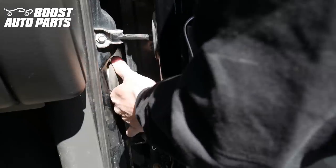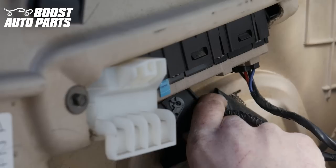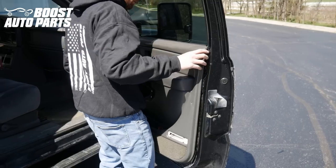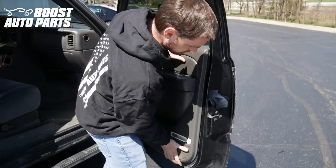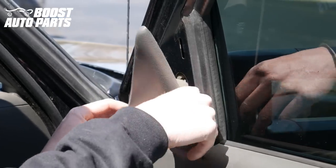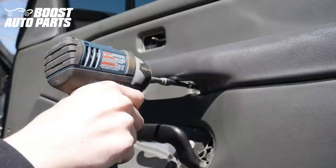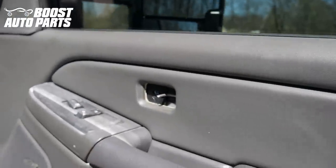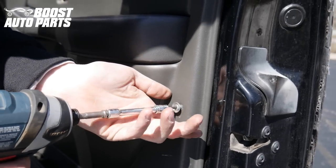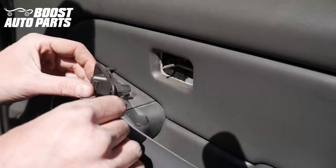We'll go ahead and snap the boot back in. Go ahead and plug the connectors back into the door panel. Now to put the door panel back on, it should just kind of latch down — you do have to make sure that the wires are clear of the latches. We'll place the foam back in over the mirror, then go ahead and latch the trim piece down and push it in. We'll go ahead and put the 7mm bolts back in — the longer one goes by the door grab and the shorter one goes right up here. We're going to use the T15 to put this back in, and the dust cap will just go right over that. Put this trim clip back in over here.